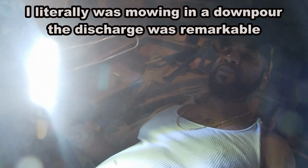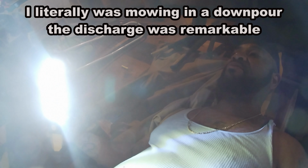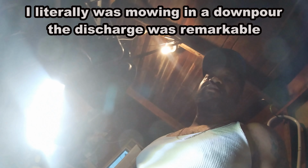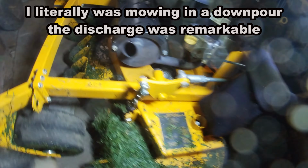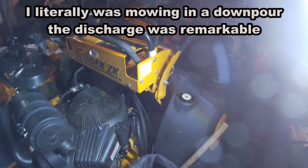Yo, I'm very impressed with the pitch adjustment that I made and the baffle removal. I'm sorry, Wright? Y'all need to get it together and get that baffle thing removable. These mowers turn into a whole different machine. They're able to cut in the wet grass and they do very, very good. Get you a Wright and you might have to make a few modifications.